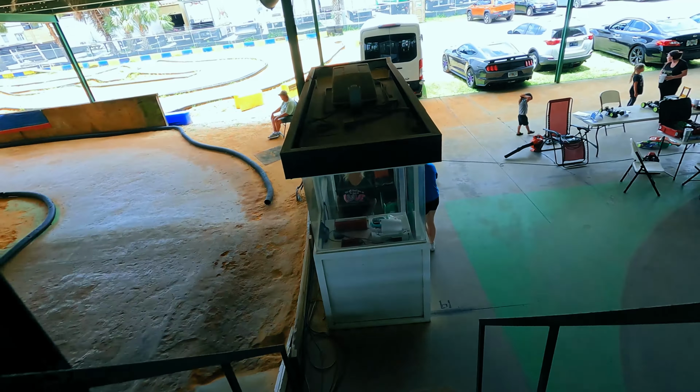The other thing that I did on this vehicle is because of the way the steering system is set up, let's see if I can get down in here. This rack right here, see right where I'm pointing at, is on a rod that runs up and down there, and it loosens up on its own. It's just down into plastic. So what I did was I just drilled a hole right there so that I could reach in there with a screwdriver and tighten it back up. I'm sure that it's lost some of its integrity, but I'm not really concerned at this point. It's better to lose a little bit of integrity and be able to tighten a bolt that's going to stop you from being able to race. That way you don't have to take the whole front end of the car apart.